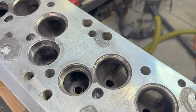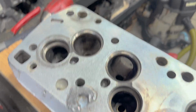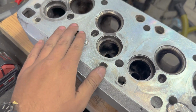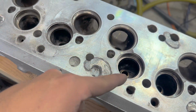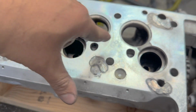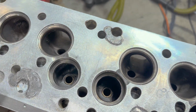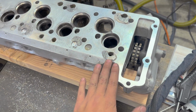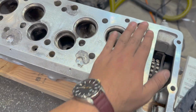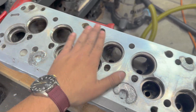And that's what that's going to look like after the peening. Now, it does distort everything around the peening, and depending on how hard you've pushed it down, you pretty typically would expect low areas directly around the weld. It seems that this deck is quite thick, so I really don't know what it's going to look like after surfacing, but I think I'd at least take another 10 thousandths off of this deck.